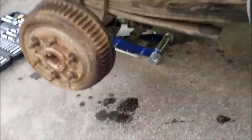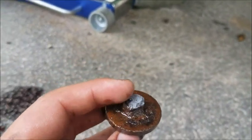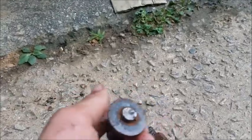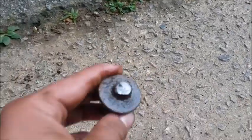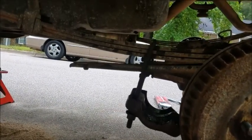While taking off the U-bolts, that's pretty much what my day looked like in a nutshell. You think the stud is bad? Check this out — one, two, and three studs broken off. Well, that's one less part we have to take out. That broken piece is going to need to be removed too so it can't be left dangling.